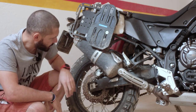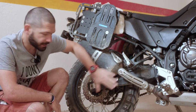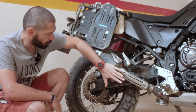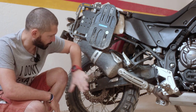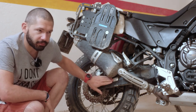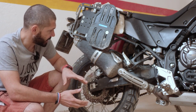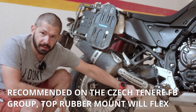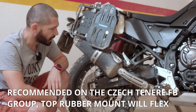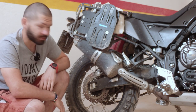Two quite famous issues: when you drop the bike — as you can see I've dropped it quite a few times — the exhaust gets pushed toward the swingarm and rubs against it. Mine is quite rubbed off already. I haven't found a solid solution yet. You can loosen the bracket so the exhaust moves a little more, or change the piping and move the exhaust to a higher position.